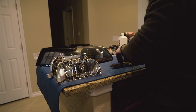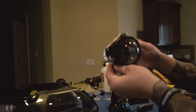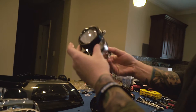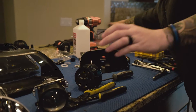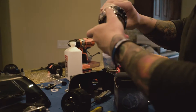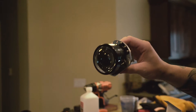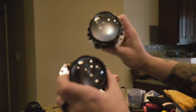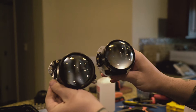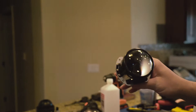To give you an idea, this is very similar to the projector that was in your light — just a cheap, garbage projector. And then here you have the upgraded one — you've got a solenoid for the bi-xenon in there as well. If you just look at it, it's a better constructed projector. Also, that's a three-inch lens versus this two-and-a-half-inch lens. That's another reason why your output looks more clear and more focused.